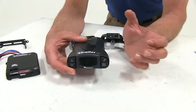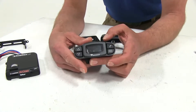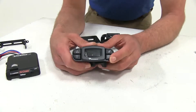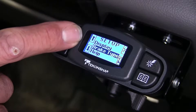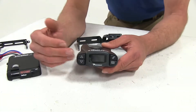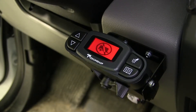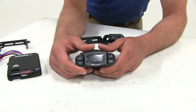With the P3 we're going to get all the same features we just talked about with the Tri-Flex, but it seems like it's built more solidly and it's easier to use. We've got our manual override lever, our gain adjustment via up and down buttons, our boost mode, and a menu. The menu allows you to change the display color, go into help mode, and switch from electric to electric over hydraulic — so this is going to work with all electric over hydraulic systems. The ease of use of the P3 and the feedback from the screen is outstanding; it gives you actual troubleshooting feedback, not just codes. It tells you what's going on, and that really ranks highly with us in the shop and through customer reviews.